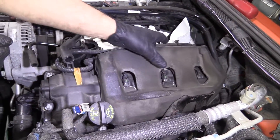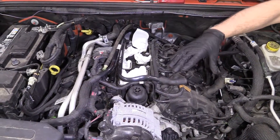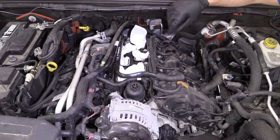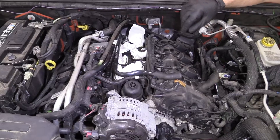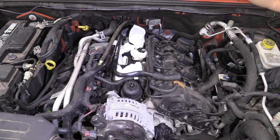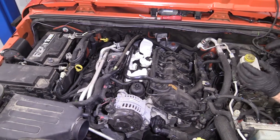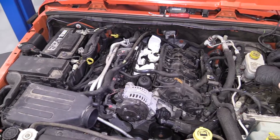I'm going to pull this insulator up and slide it out of the way. Now we have access to both side coils and plugs — it's nice and open over here and the other side. You could actually do the other side without taking the intake off, but you might as well get the intake off so you can access all of them at once.